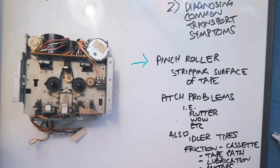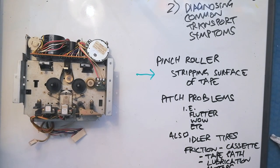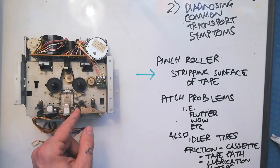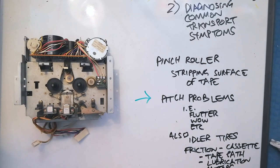Last of all let's look at the symptoms associated with the necessity for a change of pinch roller, and we'll also have a general look at pitch problems since that can have a range of causes. Pretty much the worst thing that's going to happen to your tape if you need a pinch roller replacement is stripping of the tape surface. If a tape sounds bad and you look at it and there are bits missing — like someone's taken cellotape to it and some of the magnetic covering is gone — that's the surface of this rubber becoming sticky. In early stages it'll leave bits of the pinch roller on the tape, and in a really bad case you'll look at the pinch roller and it's actually covered in the metallic shiny brown surface that type 2 chrome tapes have. If the pinch roller is really rough that can manifest in pitch problems — a regular flutter and similar issues.